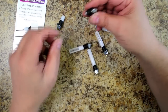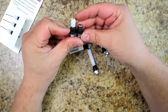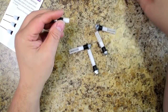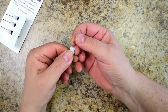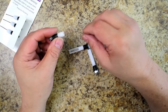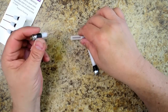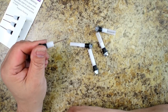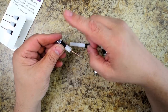The way these work is you essentially loosen the well nut and pull it out of your tank. They're both three-eighths, and then you put one of these in and tighten it down — that just replaces the probe. You'll see they stick in the tank much further. This is a piece of Teflon that goes all the way to the end. You can see here it's a little bit discolored, probably from a little oxidation in the package, which is okay — it's going to still work. This Teflon tube — water doesn't stick to that. If you take this and dump it in water and pull it out, you'll see the water just fall right off. That's how these work: they keep the water from going from the measuring tip up through the gunk to the next one.